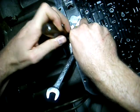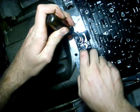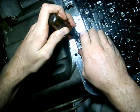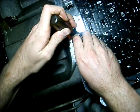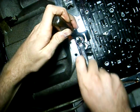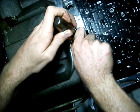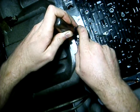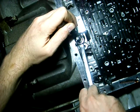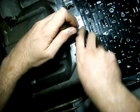I already started getting mine out but this is basically how I did it: you get the wing nut on far enough so you have tension on your wrench right here, and then you smack it. It's kind of like an impact hammer but there's no hammering action — you're just levering it. The wing nut can be a bit of a pain; you can use a regular nut too, preferably not self-locking. So you get it like that and just kind of hit it — that should loosen it up.